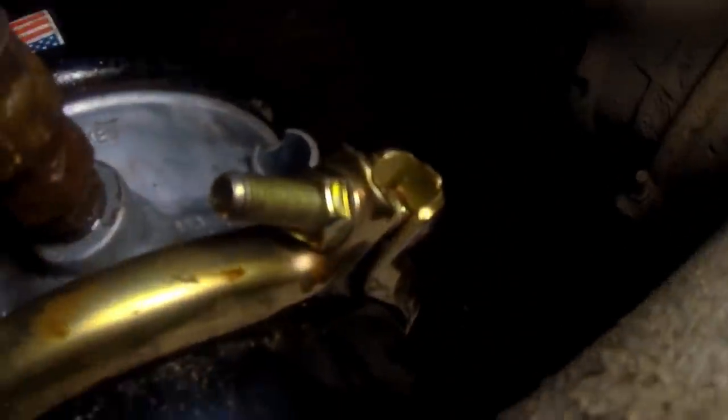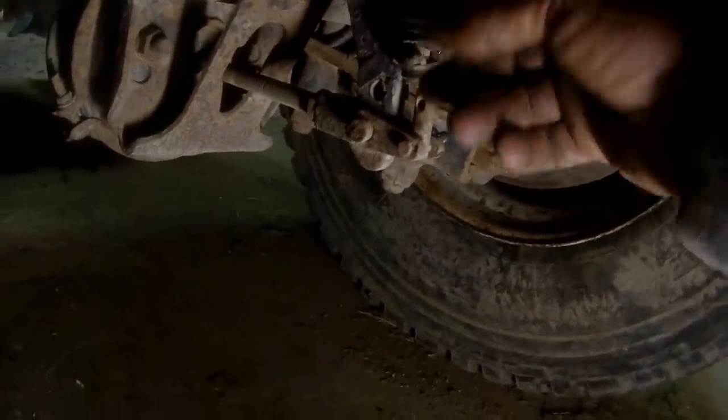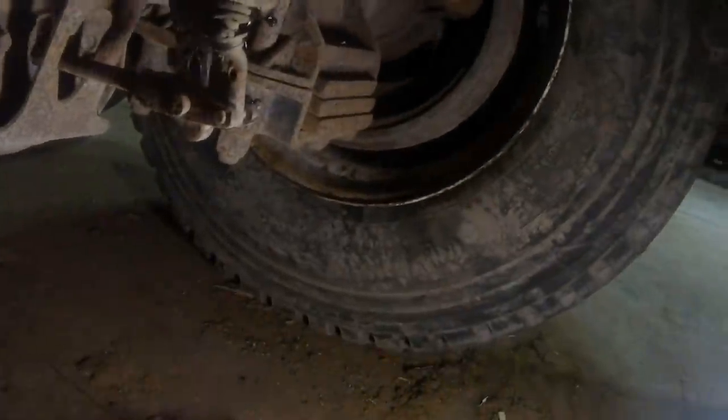Okay, what we have is our service line and our emergency line hooked up. We got our pins in the slack adjuster. Now, these slack adjusters had a small stud on them, I don't know, like a 7/16 head on them or whatever. We pounded these half inch nuts on there so that we had a larger surface to be able to run that adjuster. Now Jared's gonna supply me with some air here.